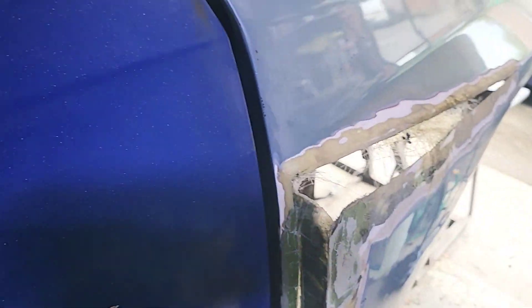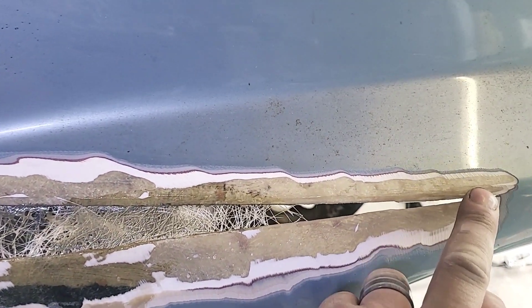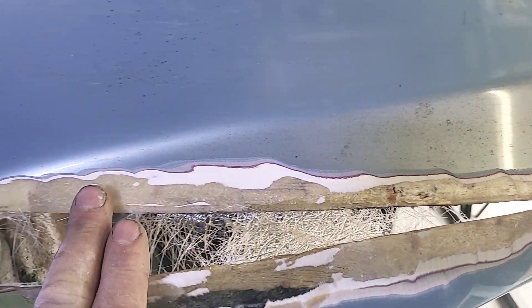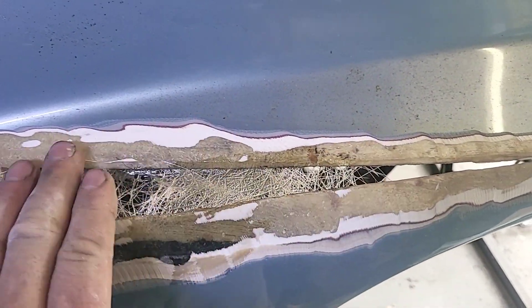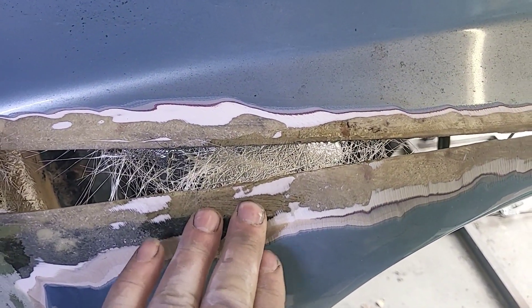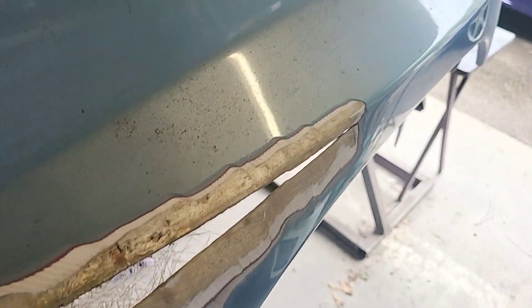You can see the detail inside. I've got quite a bit of wiggling and working to do to make it similar to the other side. What I'm going to do now is take the wing off, tape this up over here to get this edge, and put another couple of layers of fiberglass on the inside just to make it a bit more solid so I haven't got that flex in it. Then once that's done and I've got the shape right at the bottom, I can concentrate on getting the back right.